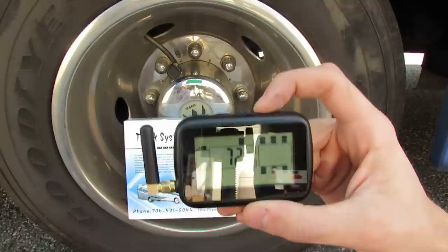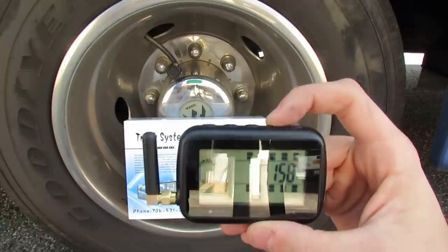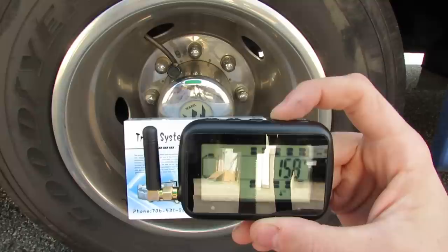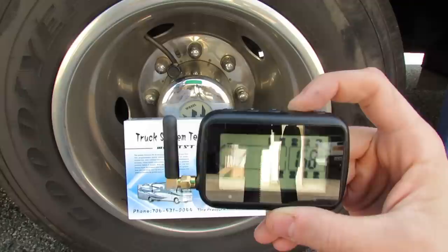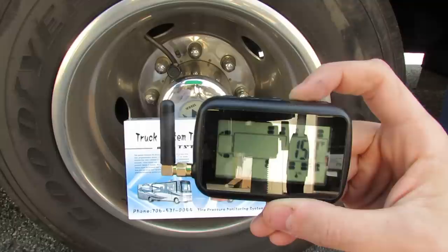Continue that for your trailer tires. When you finish the trailer tires, you'll come up to the temperature setting. 158 degrees is the basic setting for the monitor. The Michelin standard for tires is 180 to 200 degrees, at which point your tire will begin to fail. Our monitor will let you know of brake calipers, wheel bearing issues, low pressure, anything like that. If you have a problem, this monitor is going to tell you exactly — hey, you may want to pull over and fix that right away.